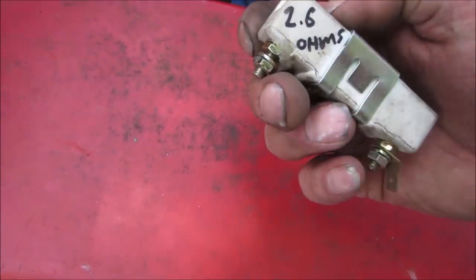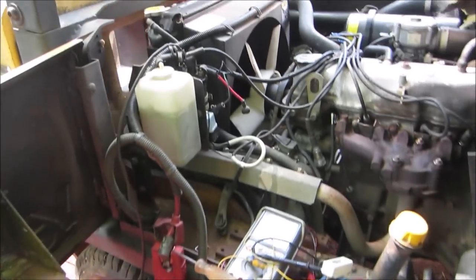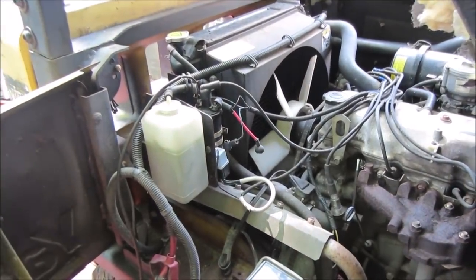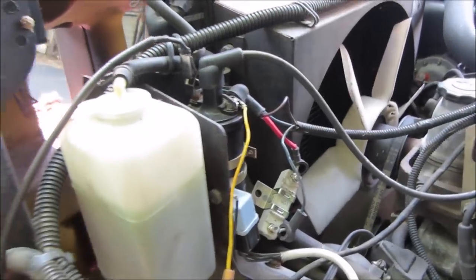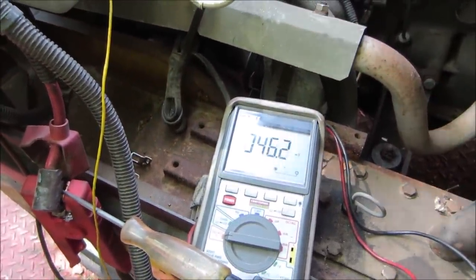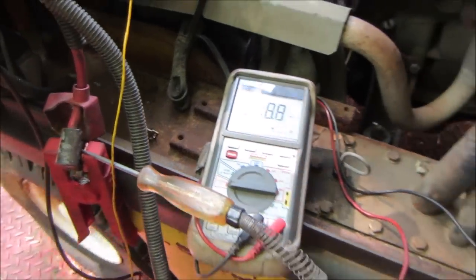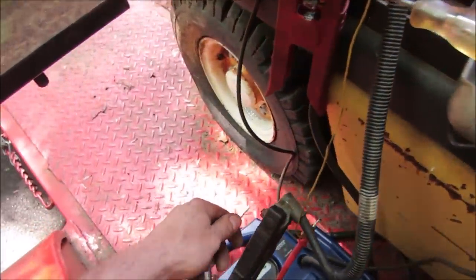In my stash I have one that I think I wrote on - 2.6 ohms - I'm going to throw that in there. I don't even know if it's supposed to give a voltage drop or if it's just a buffer for it. I threw the other one in there, turned the voltage on - we should be getting voltage at that coil right now and we are not. Why? The ground is not hooked up. There's your problem. 12.83 volts.